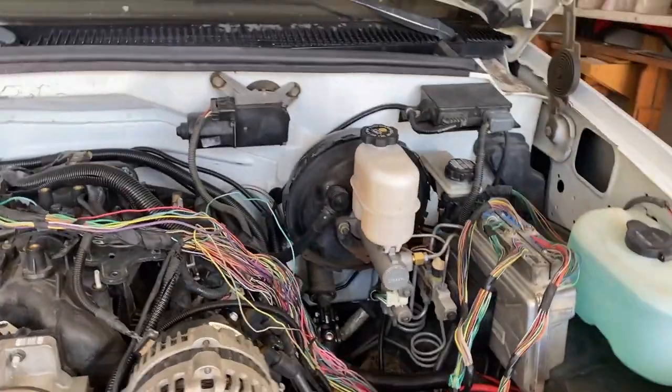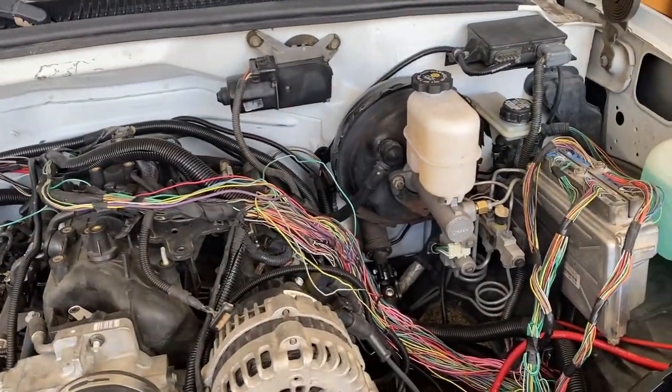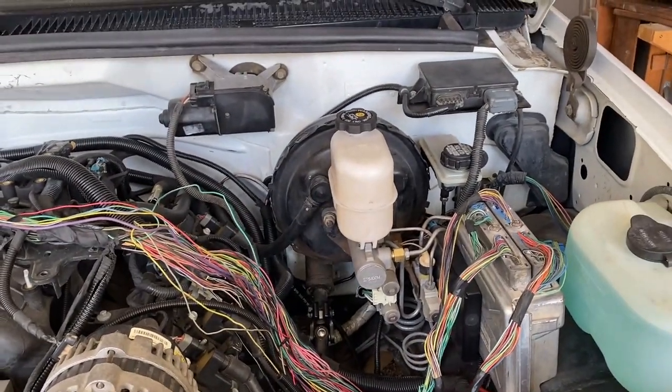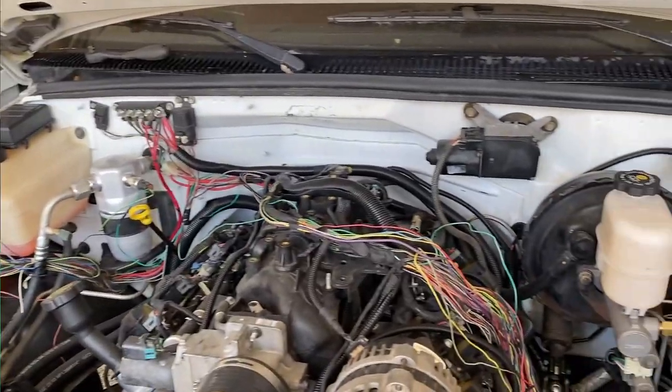There's still a bit of a mess here, but there's one last item that needs to be addressed before I can tidy all this up, tape it up, put plastic loom on it, and make it look nice. The check engine light is on. So now with the temperature sensor reading properly, the fans coming on, the air conditioning working, and the AC fan taken care of — we've got all that done except making it look pretty. I hope you found the video helpful. We've gotten a major thing accomplished today getting that AC taken care of. The last thing is to get that check engine light to work properly — or in this case not work, because it's on. I've already tested it with a remote tester and it's not the LS, so somewhere it's connected to the old OBS PCM and that's causing the trouble. Next time we come back we'll figure out how to fix that. Thanks for watching.